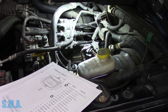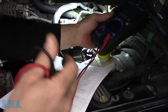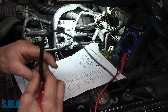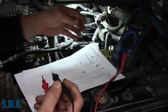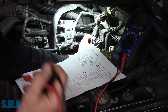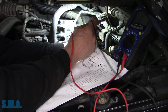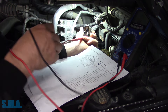Let's grab a meter here - the multimeter kind. One and nine - so number nine. One and nine, let's see - nine is brown with tan. So we're going on this connector: brown and white is the power feed, and brown and tan is the number four injector. And the survey says... it's auto-ranging. Nothing's happening. Why do we have no continuity between those two? We should. We don't. That doesn't make any stinking sense. Brown with white - that is it. I'm on the right side of this harness, right? That should be the harness that goes into the intake, and it sure is. Why does that show open circuit?